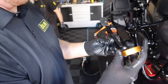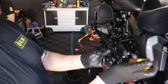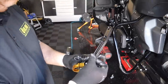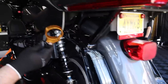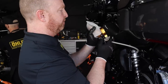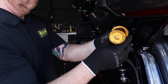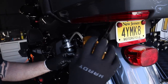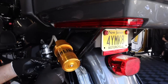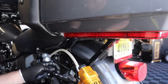Next is to mount this on. We're putting the clamp on the inside so the clamp nut isn't visible from the outside — spin it around so your clamp nut is on the inside. Now we're ready to get the reservoir into the reservoir clamp. Do that before you put the two bolts in, because you won't have the flexibility to put it in after. You'll adjust the location of the sticker on the back once everything is mounted. Note that you've got one longer spacer because on the back side it's deeper for the offset.